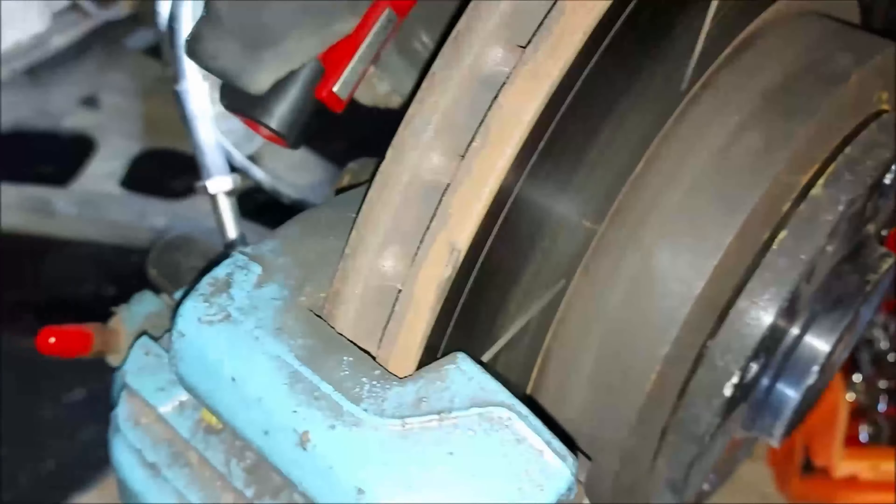Before I could get to there; now I could get my whole arm in there — it's terrible. I'll measure it up, but I reckon it's about two to three centimetres. That front right is actually 1.4 centimetres higher — quite a difference. I suppose that goes to show that if you replace the springs the way I did and undo all the locking rings, you might not put them back on very consistently. Ideally you'd lay them both next to each other so they matched up. Probably just the way I've set them up.